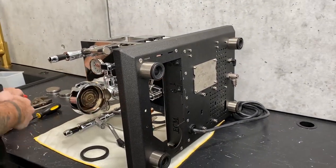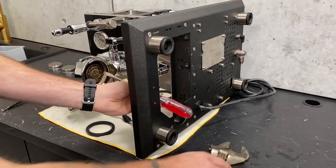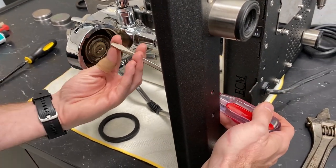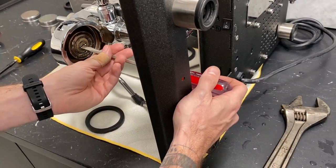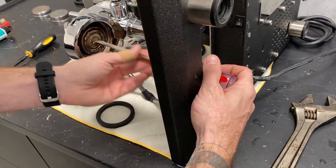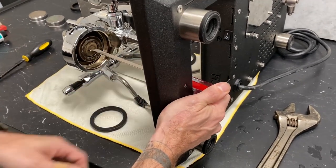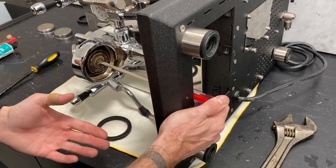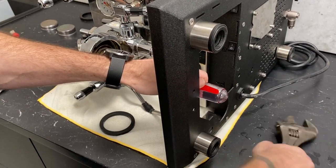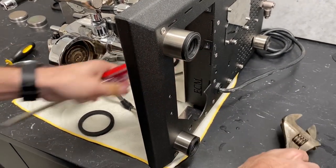This next part is also not in the other video, because you have to take these parts off and I just wanted to stress that. Up here you have your shower plate — it's a slotted spot. You're going to need a wider slotted driver for this because it's got that little notch in the center there. Those can be pretty tight and kind of stuck. You get a lot of coffee oils and residue in there which will make it kind of tough. This is where it would be a good idea to put the machine on its side, because it's going to give you a much better vantage point. If it's really stuck, you may need to throw your wrench onto your screwdriver and just give it a hard turn — just be careful because it is brass and you will start to chew it up.